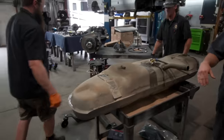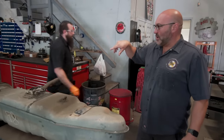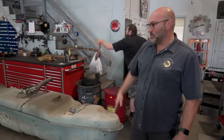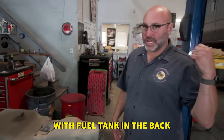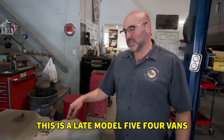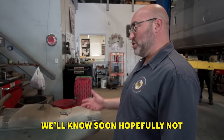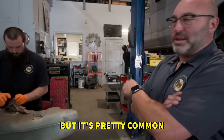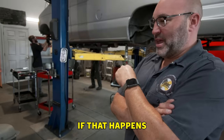How much of this do you cut off? We cut it right here - it's going to lose just this, about three gallons. Now this will get sent over to the fab guys and they will drain it, clean it out, cut it, and weld it. Not all vans need this - obviously any cutaway chassis or fuel tank in the back doesn't need this. The late model 5.4 vans don't need it because it just barely fits with the T-case. We'll look and see the condition of your tank and see if it's delaminating. How often does that happen? About 40-50% of the time. And we'll know soon - hopefully not, but it's pretty common. If it's delaminating, we'll switch gears - we usually have at least one or two fuel tanks around. If it's real bad, we'll replace the tank.